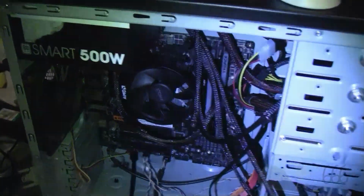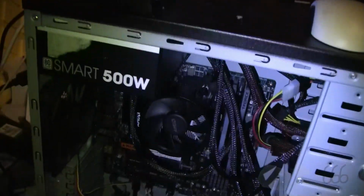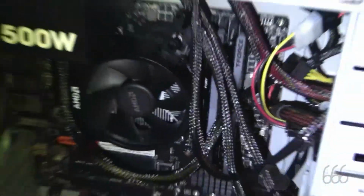Okay. Here we are, ready to go. With the heatsink, you'll also notice the wire is routed properly. Again, a lot of the ones I've dealt with recently don't have that routed. They have it routed the wrong way, such that the way that you'd think to install this heatsink would put that nub right up against the RAM slots, and that's not going to work. So, speaking of working, let's see if this works now. Probably not, but, you know, we could hope.